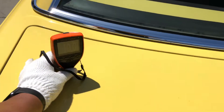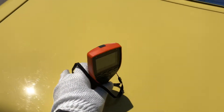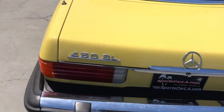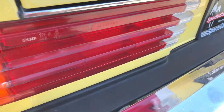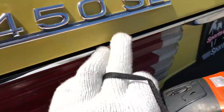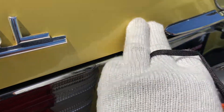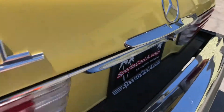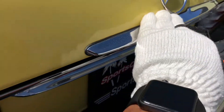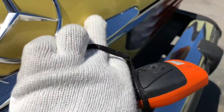Lines look pretty good here. Getting these readings: ten, twenty-one thousandths of an inch, ten and a half, eleven, and nine. Here I noticed some more signs of rework or paint. You can see paint runoff right here in this area, prep issues, and pitting in the paint — usually that's due to contaminants. Chrome here is going to need some attention. And then you can see some paint blistering here, here, here, here.